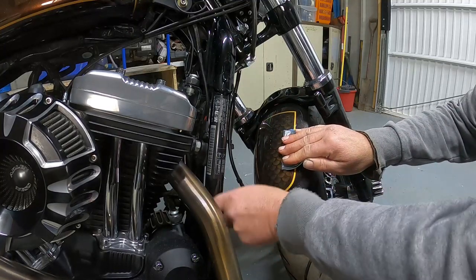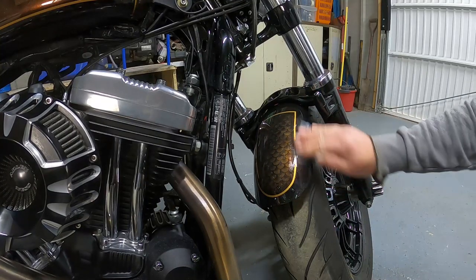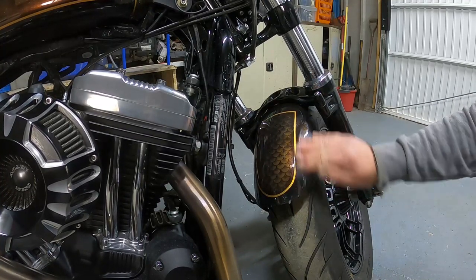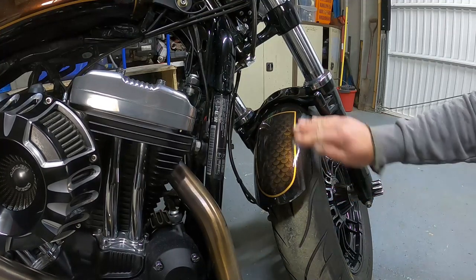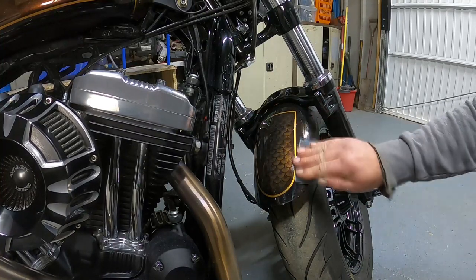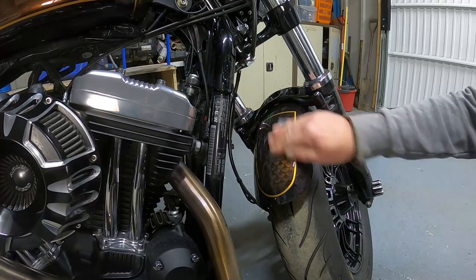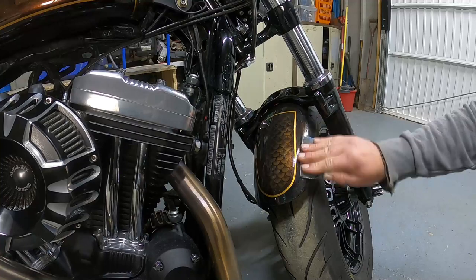Probably some of you are now thinking, that's sacrilege, they're taking the shine off the paint. Sandpaper on the paint on the fresh 2K lacquer. But don't worry. In fact, every time you do this, all you're doing is putting a flatter finish on the paint, and the flatter the paint, the better the shine. Obviously, if you put a microscope up to a flat finish, there will be a lot of undulations. And when you take them out, hence more the mirror finish.